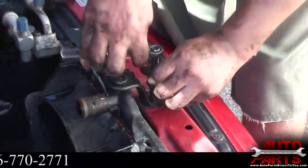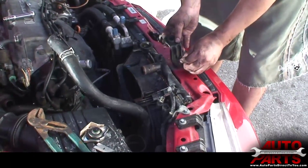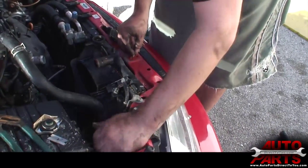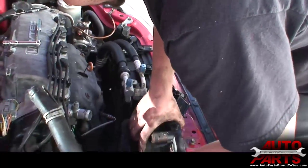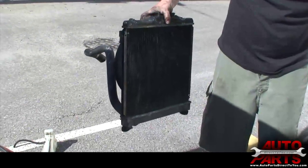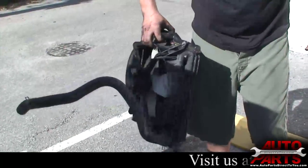We're going to start taking the radiator out. Look all around the radiator and fan to make sure nothing else is plugged in — no wires, no ground straps. Remove the mounting bolt and put it somewhere safe so you don't lose it. The whole radiator and fan assembly is now loose and should lift right out. There's the old radiator — all rotted, fins broken, full of bugs, and leaking at the top seam. It may have been leaking at the bottom too, but it could just be coolant that ran down.